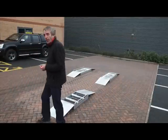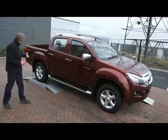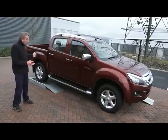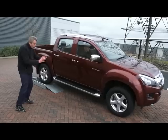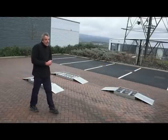Now let's have a look from the other side. When we try and set off, you can see that wheel spin is initially generated, but quickly the brake traction control system transmits the power to the front wheel and the pickup drives easily off the rollers.